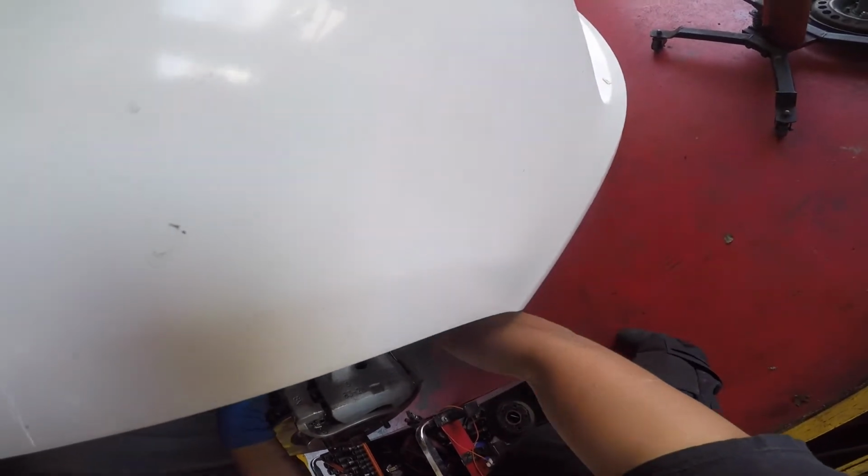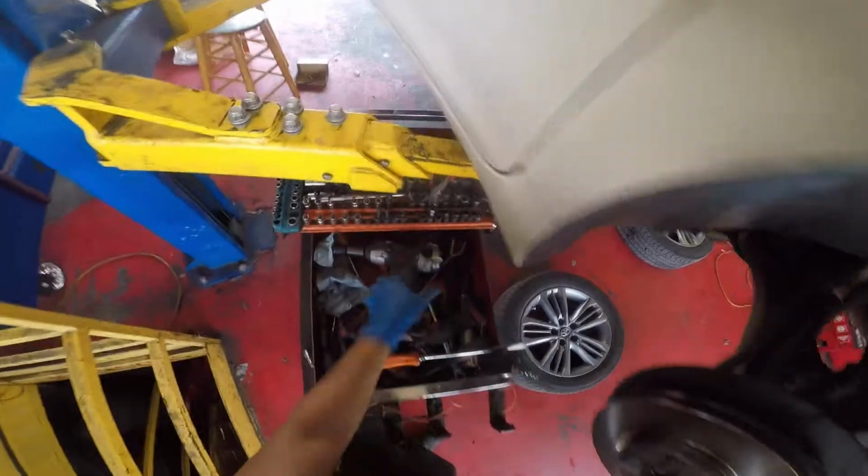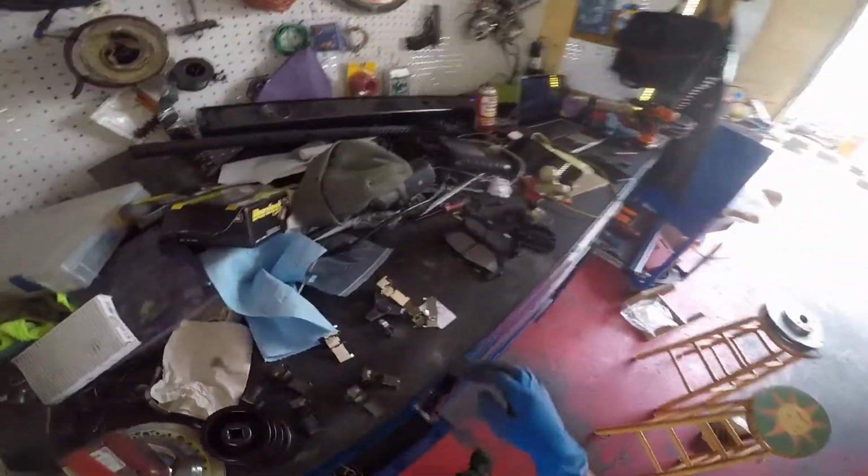And you see the sensors? I put them up on top of it. You want the wear sensors to be in the forward position where the pad makes its first contact, because that's where it'll wear out the most, and that's when you know you need brakes.